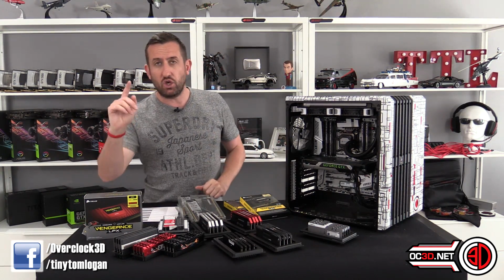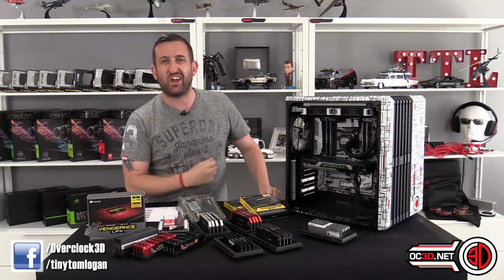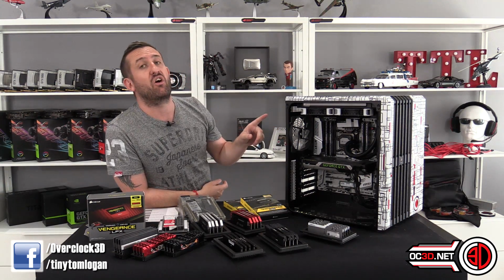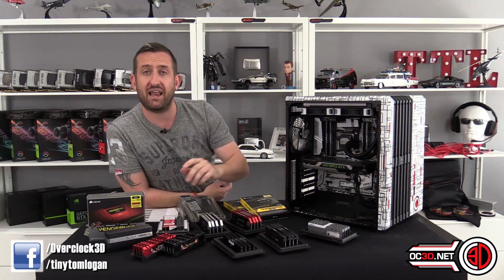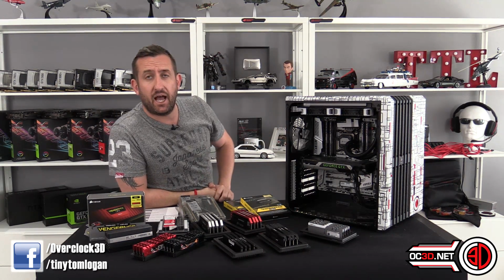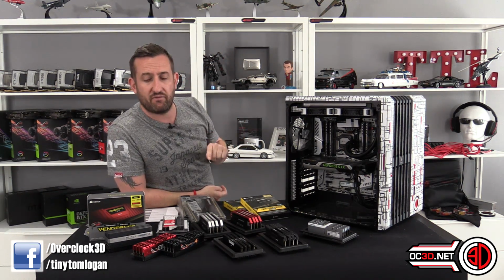You go to the store where you're going to buy your board from, the e-tailer, you see a bundle with the LPX and you think to yourself, I don't fancy LPX, I want some of the new LED. Or I've already got, from my other X99 or Z170 system, some 3200 megahertz Klevv. I know that memory works, so I'm going to buy that. You get it in, you start building, you press power, and it doesn't post. It just keeps cycling. You see the little lights going around all the time.